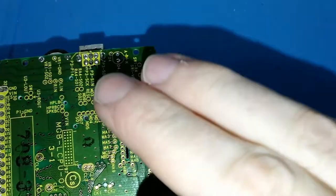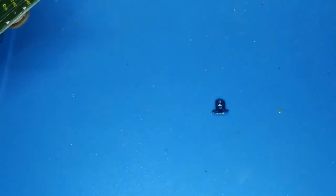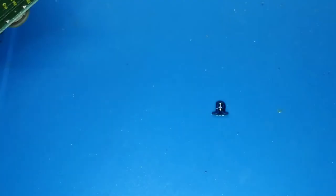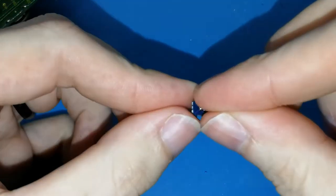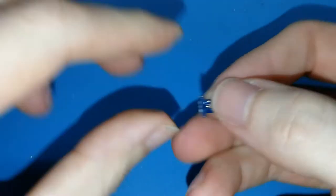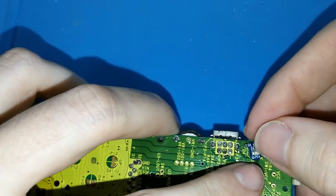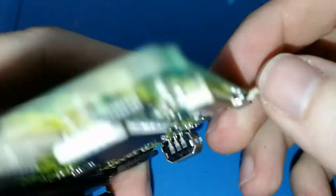Anyway, because this pocket has a light, we can take our small board and put two drops of tin like this. One and two. It's really small, but you can see two drops, perfect. Now we can center the board. Take care, you are putting the pads outside, okay? And the lights inside.